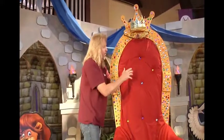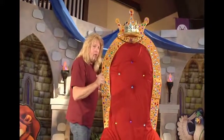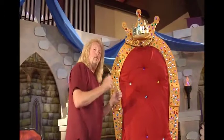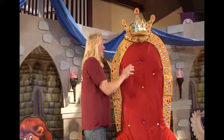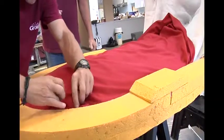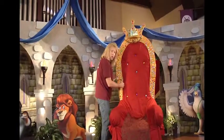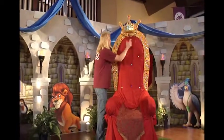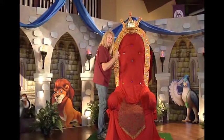We got batting — volunteers ripped it up and we used spray glue. Be very careful: the spray glue must be for foam, because if it's not, it will melt the foam — very important. We sprayed the glue, tore up the batting, glued and patted it down, then added another layer of batting glued along the edges and down the back. Then we laid the red fabric on, cut it to the contour of the seat, sprayed glue around the edge, and tucked it in. Not one stitch — it's all glue!